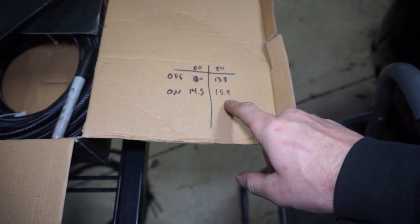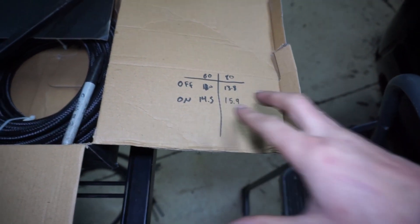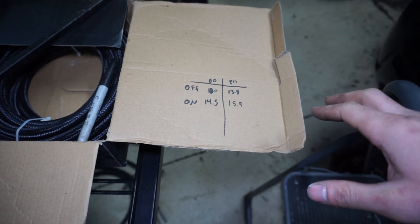Interesting result there. Remember when I said I tested it on the Ranger and two pumps were pulling about 32 amps? When I measured here it was basically 16 amps — that would be 32 amps with two pumps — and it came out to about 14.5, so that's about 30, which is right in that range. So the circuit I need to build should be good for about 35 amps at the high end. I'm going to build it for 40, but I just wanted to show you how I was figuring that out and what the Walbros actually run at, because I've heard some other numbers but I've never actually measured one running up near 35 amps.